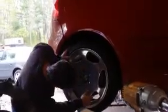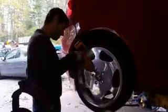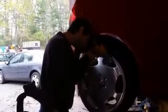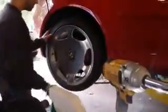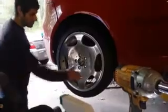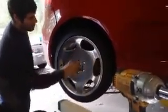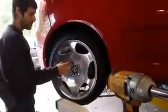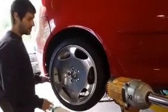Are they fully seated? It might be, because the taper is a little different. Does it feel, are they not loose, right? They sit snug in there. So we'll see if we're up against the hub. Yeah. No, I tightened the shit out of them. They put up a little resistance before they were fully tight. They're the same width as the stock, right? The stock ones? Yeah, they're definitely the right thread. It's just the hub, you know, when you put the wheel on, the hub has to fit over the hub on the brake rotor, that hub is a super snug fit, so. Okay. I just want to make sure that everything's pulled in.